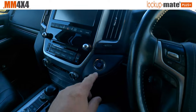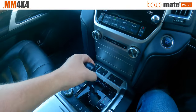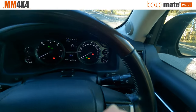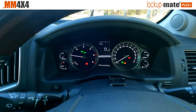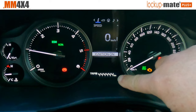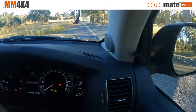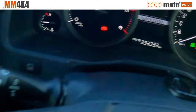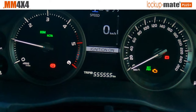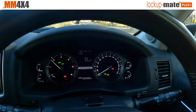You can adjust the settings of the unit. The way you do that is you turn the ignition on without starting the engine. You then move the shift lever into the sport position S, and then just press the LED. You'll see that the tachometer is displaying number one, and number four is the value of the setting. The LED also flashes with the setting of four times. And to adjust the setting, you just use the shift lever — so to put it on three, just go minus once. Press forward twice and you can see setting number one is on five. I'll put it back to four, which is the default. And then to change to the next setting, you just press the LED and you'll see the tachometer go to number two.